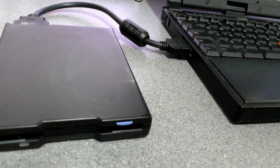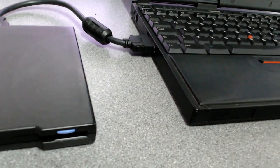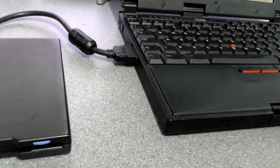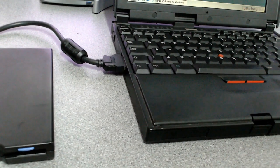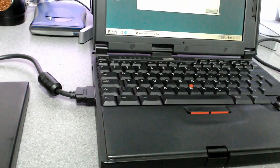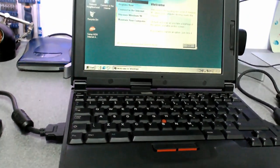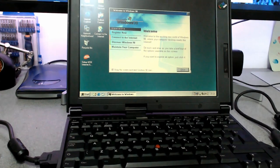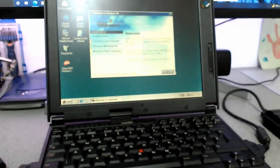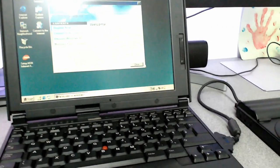Anyway, so what happened after all that was the battery was underneath, next to the RAM, which you saw earlier, and I had to order them in because I had these funny little CR2011, tiny little batteries, and I had nothing that would fit in there. The machine simply would not boot past a 161 or 163 error with a flat battery. Put a new battery in and the error stopped, but I still couldn't boot this machine, and I spent quite some time trying to work out why. The floppy drive light would come on, but it wouldn't actually boot.